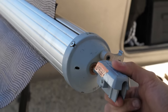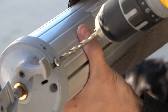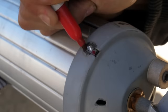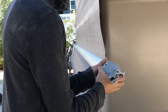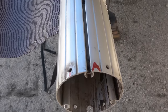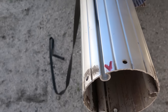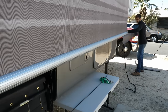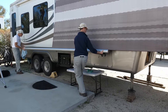Once the spring was limp, the end cap could be removed to allow the fabric to come out. We drilled out three rivets holding the end cap on, then used a screwdriver to tap the rivets the rest of the way in. We marked the end tube rivet hole and the cap so we could reassemble in the same position later. With the cap removed, we pulled the entire spring assembly out from the tube. We then marked the tracks inside the tube with a V for valence and an A for awning so we could reinstall them in the correct tracks. The valence slid out the now-open end, and we removed the tube from the awning — most easily done with three people.